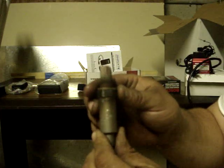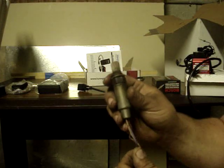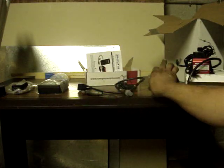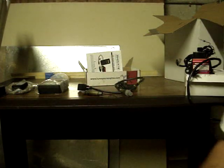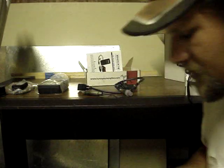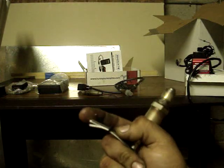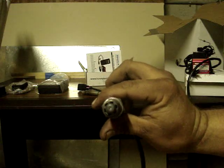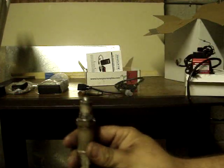The purpose of showing you this is that on a previous video you saw where my Suburban had an issue with EGTs going too low at idle, and there is a way around this. On the newer style O2 sensors, if you order a Bosch 15730 — this is a universal style — it's going to look like a wideband to most of you, but it truly is not. They've changed the design to make these things stay hotter longer at idle because manufacturers saw it was a problem. You see the four wires — it's just a standard heated O2 — but if you look in the end, you see the holes are in the end like a wideband, but it's shielded, there are no louvers, so it stays hotter longer. This is working out really well in my Suburban.